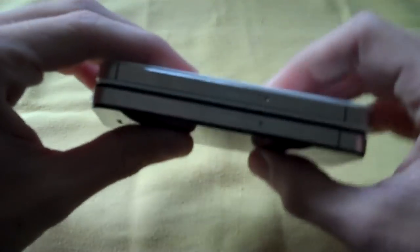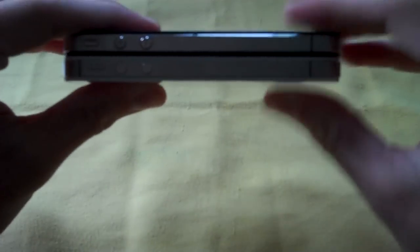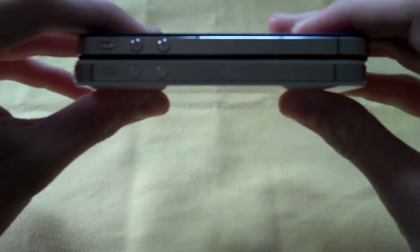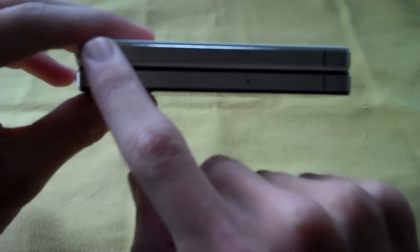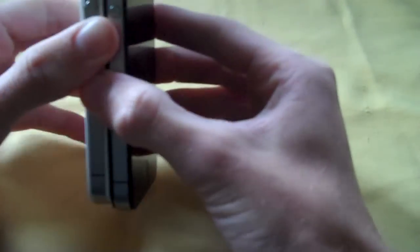The antenna design changed with the new iPhone. On the old GSM iPhone 4, they all have SIM doors in the same place. The antenna design has changed due to the death grip issue on the iPhone 4 — if you held it during a call or while using cellular data, you'd totally lose your connection. Now they've redone this. The black antenna bands have moved: the one at the bottom is still there on both sides, but on top they had to move the hold switch down on the 4S to make room for another antenna. On one side there's no antenna on the iPhone 4, but there is on the 4S.